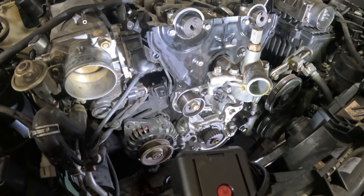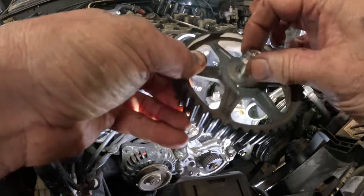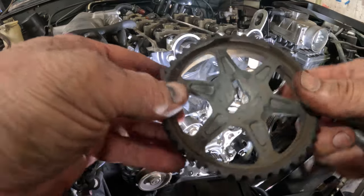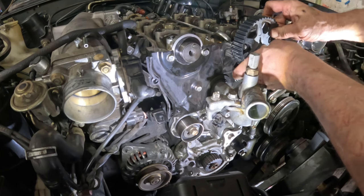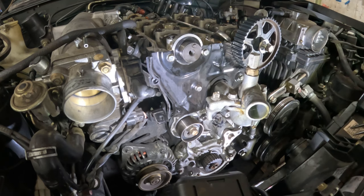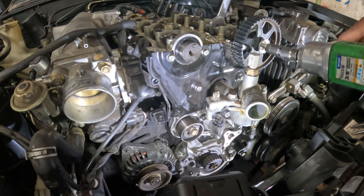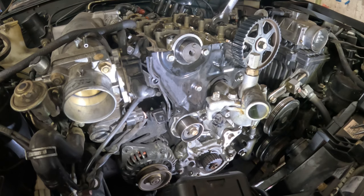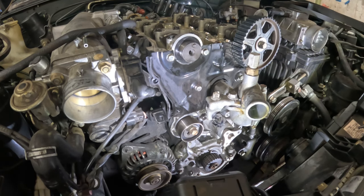And now we need to focus on these. Get the exhaust side, it says E right there. Exhaust straight up. Of course, it's not exactly straight. We will tighten it and then we will straighten it out. Hold backups on the camshaft. Torque this down. Torqued. Perfect. Other one.